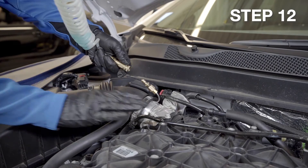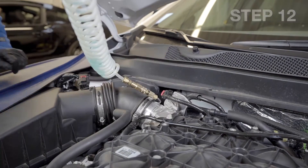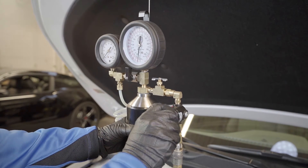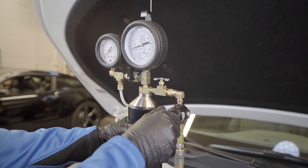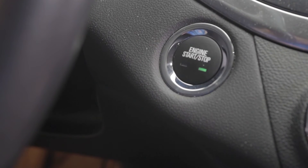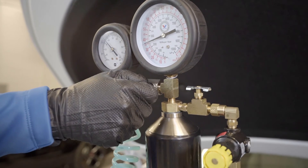Attach the shop air supply or hose to the VPS Complete Intake Fuel Rail device. Adjust the air pressure to 30 to 40 psi by turning the regulator knob clockwise. Check for leaks throughout the apparatus. Start the vehicle and allow it to run at idle — always stand at least two feet from the vehicle when starting the engine. Slowly open the ball valve shutoff valve to allow product to start misting through the sprayer.